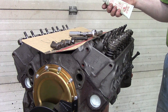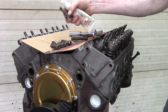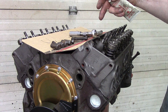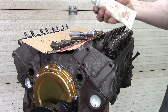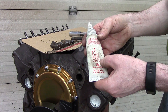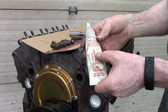As I said in a first video, all of your bolt holes in your block and your bolts, studs, whatever you use, all need to be chased with a tap and a die to clean them up so that you get proper torque. Now on the head, you need to use — on a small block Chevy — PTFE Teflon-style high temperature thread sealant.